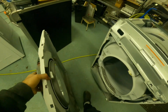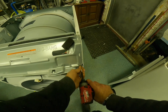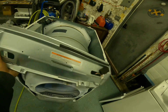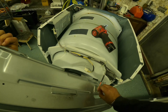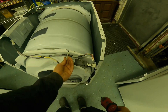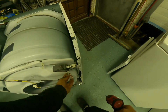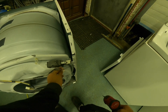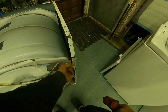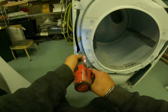Grab the screen. Once you unscrew the top support panel — I think that's what it's called — untwist the wires and note the pattern because I always mess this up. Now, if you haven't noticed yet, this dryer all it needs is a simple belt. And can you imagine someone threw it — to the side of the road, to the dump — because of that? But we're going to save it. On this channel, Hustle with Wes, we're going to clean it, service it, and flip it for 300 bucks.